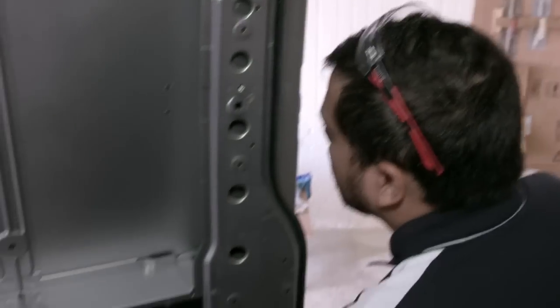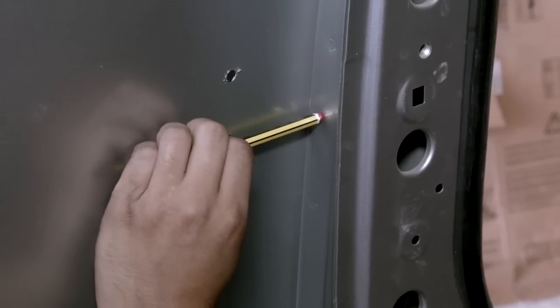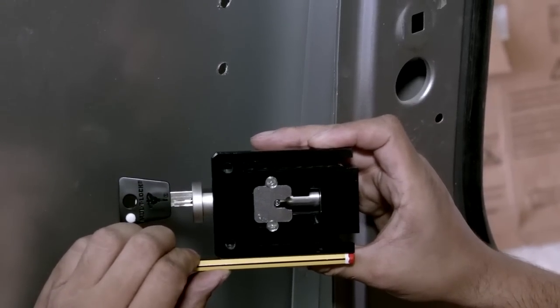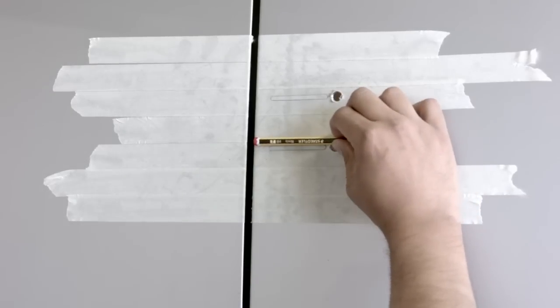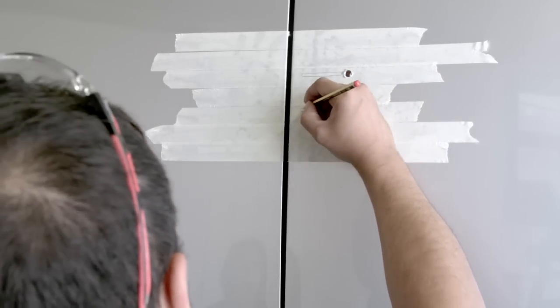Before we can drill the two remaining holes, we need to move inside the van to calculate what positions are available. Using one of the fixed holes as a datum, we will slide a pencil along the panel until an obstruction is found. On this van, we've arrived at the panel return metalwork. We can now transfer this measurement to the outside, which will allow us to identify the best positioning for the fixings. It's good practice to spread the load as wide as possible, but not too close to the absolute edge